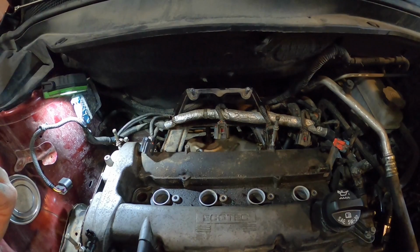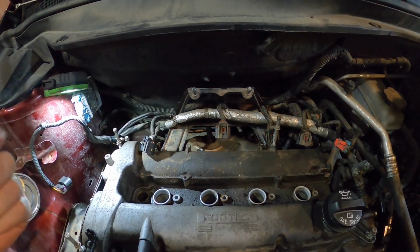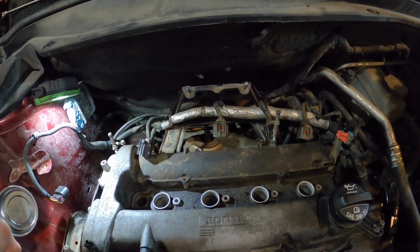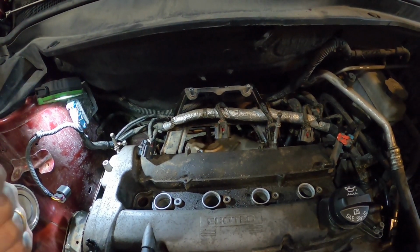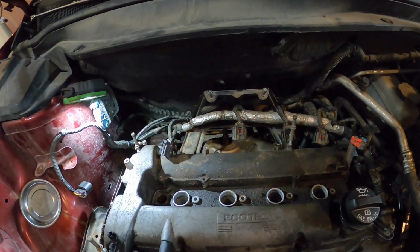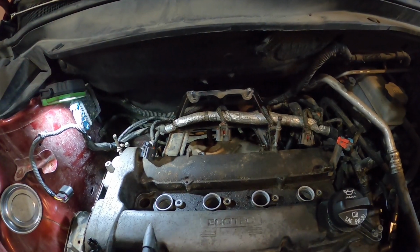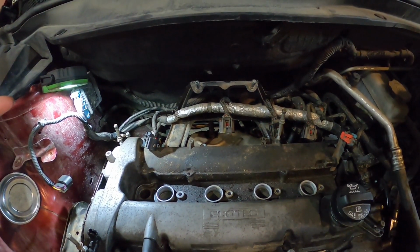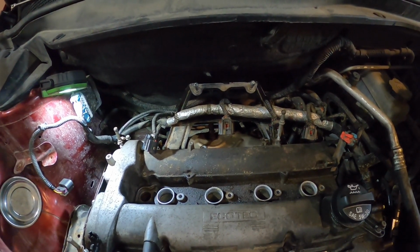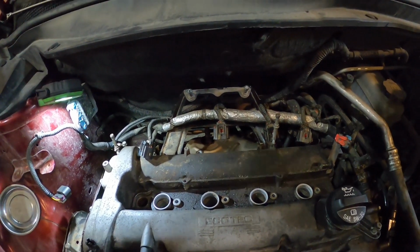It's an E7, it's the E socket for the studs. So I had to pull every one of those out, and they are not easy to get into when the manifold is back in. So that was kind of a nightmare. So if you do this, I would recommend maybe throwing the manifold back on. Now, I could have gone down and taken the brackets off the exhaust, but if any of you guys have ever messed with anything exhaust, the less you mess with, the better. So it probably would have been easier for me to do the studs like I did.